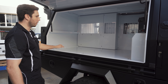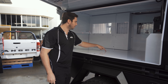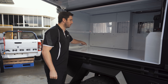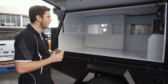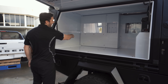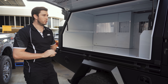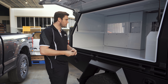All this space — we've got a false floor in here. There aren't many tie-down points, but all of these bolts here which hold the floor down go into the structural rails in the actual canopy. So you can take one of these out and screw an M6 eyelet in. Anywhere you see a bolt holding a floor down, you can replace that bolt with an eyelet — meaning tie-down points. A lot of our customers do this if they need to hold big items down. You also have eyelet points along here on all these little nut inserts, and if you want to do stuff from the roof you can hang items using a channel nut and an eyelet that threads into it.